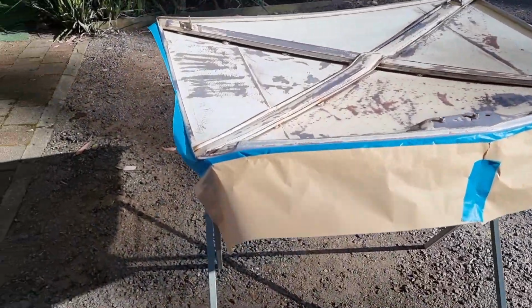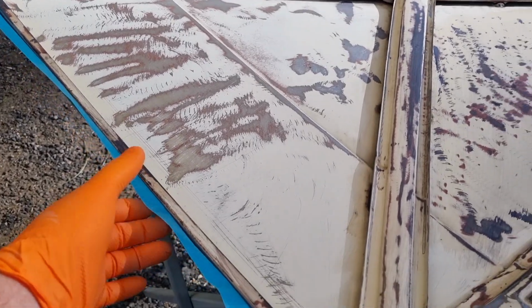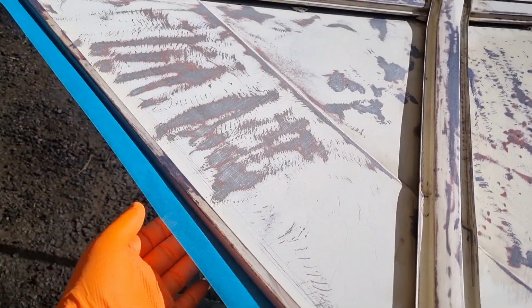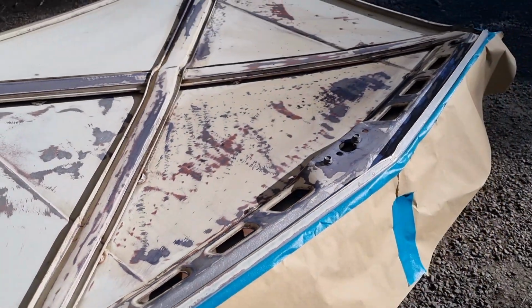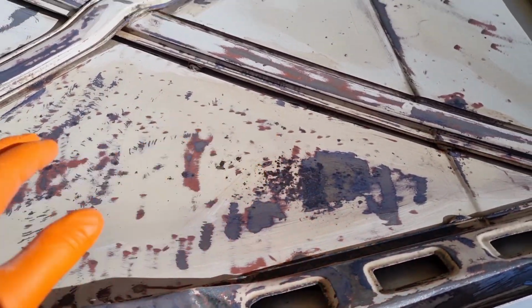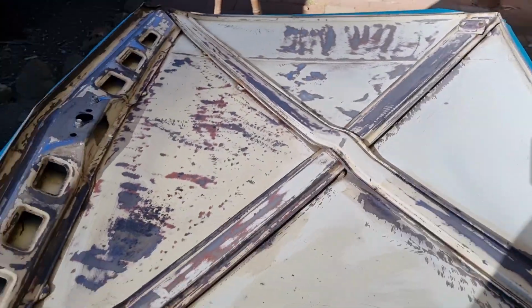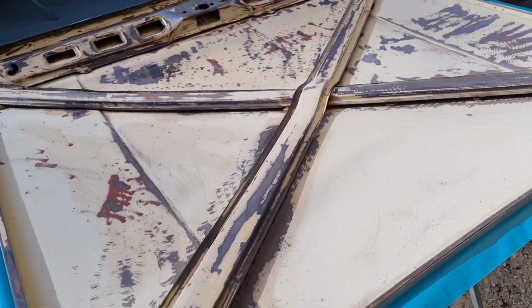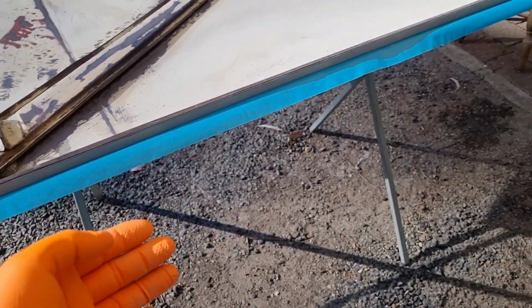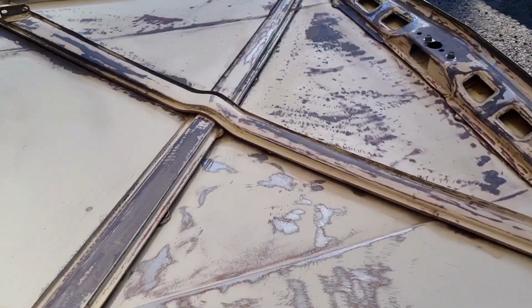It's a nice windy day, so perfect conditions. I got some soft edge masking happening here, which is managing to blow up all around. Perfect conditions. So anyway, I've got a few spots of rust that were here, just converted after giving it a good sand back down to 80 grit and a bit of Scotch-Brite as well. So yeah, I'll get this in epoxy. I've just got it soft edge masked around because I've already prepared the front of it, or the top of it, and I don't really want to have to be sanding off drift. So we'll get some epoxy mixed and get it on there.